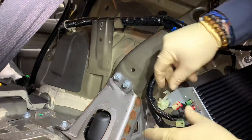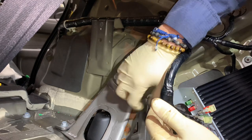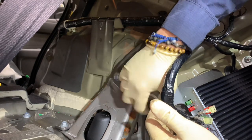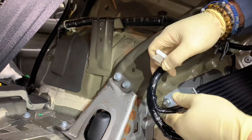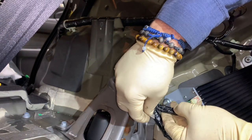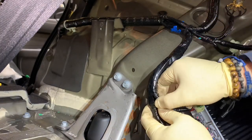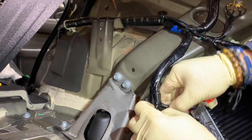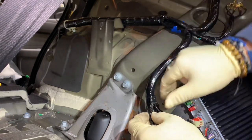This is what's been causing my issues — look at that angle right over there. We're going to straighten that out a little bit and eliminate this OEM zip tie — Honda didn't do a good job with it anyway, just toss it in the garbage. Now we're going to cut back some of the tape here a couple inches, again being very, very careful — if you cut into this wire you're going to be replacing this harness.